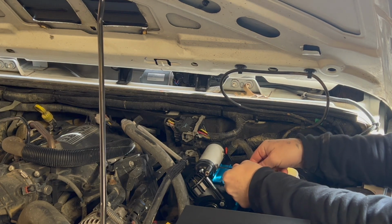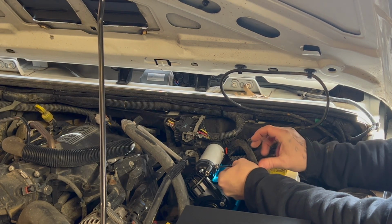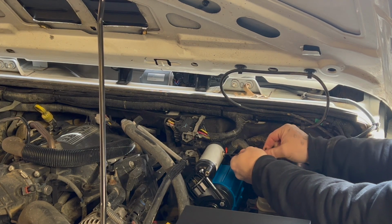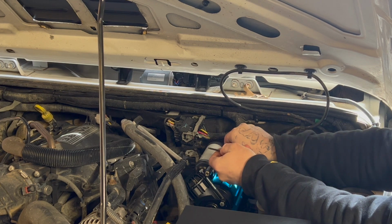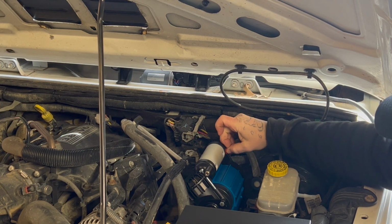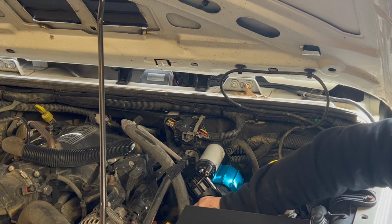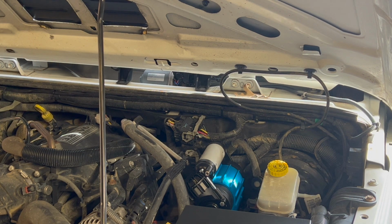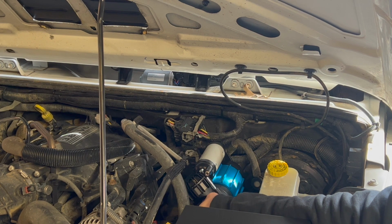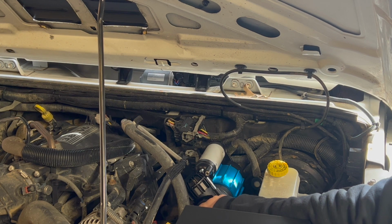Now I'm going to remove all the plugs, and we're gonna get the solenoids installed. Now this is just 1/8 inch Allen head plugs. And then once you get these out, you just throw them away. And then we're gonna go ahead and pull these little red plugs as well. Now the front is for the filter. Just gonna spin that on real quick. I already have everything Teflon taped, so I got all the valves and the solenoids. Like all the different fittings are already taped, so I can just go ahead and throw them in.